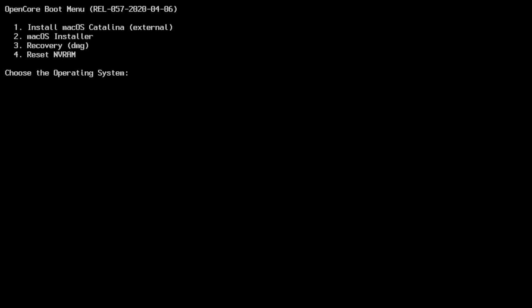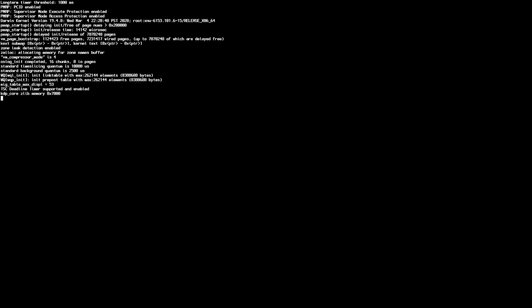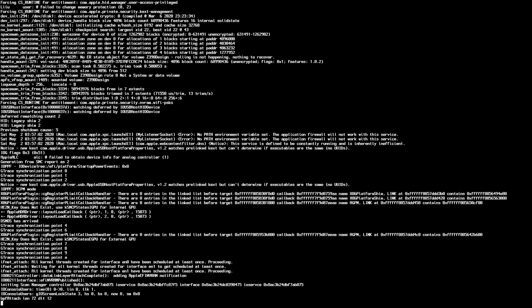All right, so once we get here, we want to choose our macOS installer, which is actually our hard drive, but that's what it's called at this point. So we'll hit enter. Okay, just like before, it'll hang on a couple of lines, but we'll get through it. Now we're going to get up here and it's going to take about 12 minutes to continue the installation. So hang in there with it, guys. It's going to go completely across this time too. Yeah, it says about 12 minutes remaining. All right, we'll come right back.